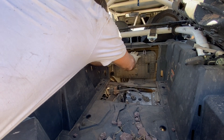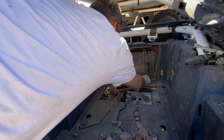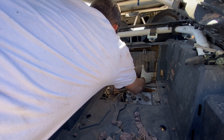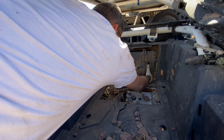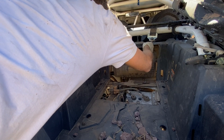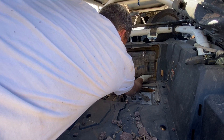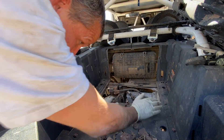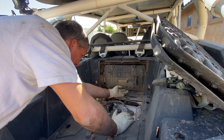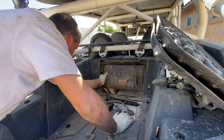A lot of people are scared to blow out an air filter, but this extends its service life significantly. At work, we blow out air filters after every job — replacing them every time would cost thousands quickly. We typically blow them out four or five times before replacing. The Polaris air filters are around $15 on Amazon, while filters on some equipment cost over $100 each. That said, remember the air filter is the only thing protecting your engine from debris — make absolutely sure it's not damaged and that it's installed correctly. An improperly installed or missing filter could ruin your engine on the first trip out.